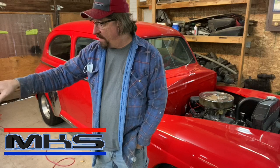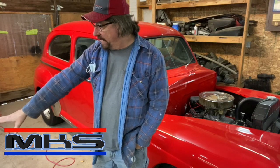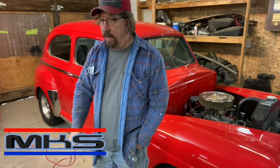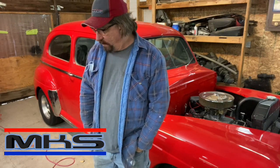It's good enough up front there. I can get a jack stand underneath the front of the frame rail, and then back here in the back and get that good and solid there. A couple more mounting points and I'll be able to just chop that out of there, get the metal on the sheet metal brake, bend up a new frame rail and get it in there. So yeah, I'm excited about that. So take that back end off of there and see what we've got, and we'll go from there. So maybe that'll be the next episode.